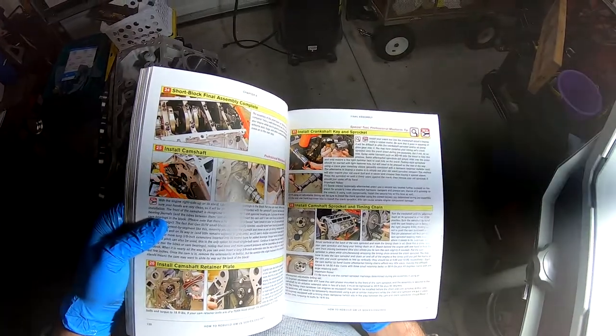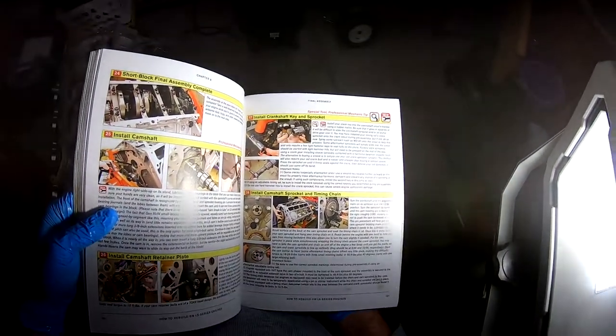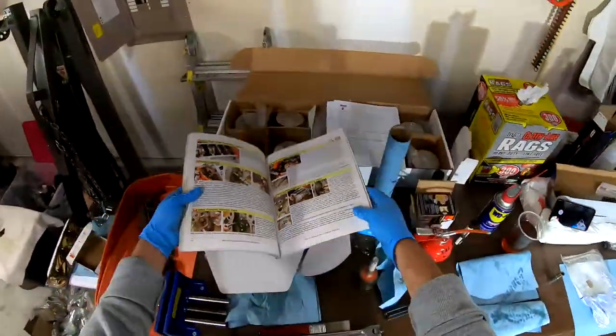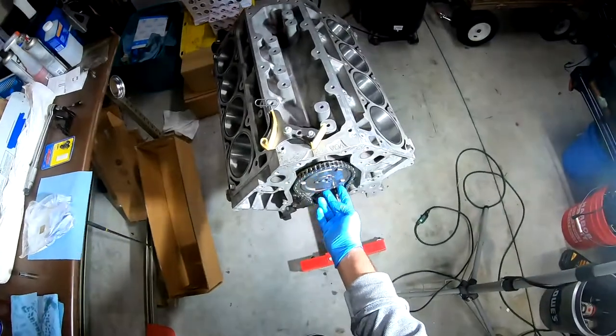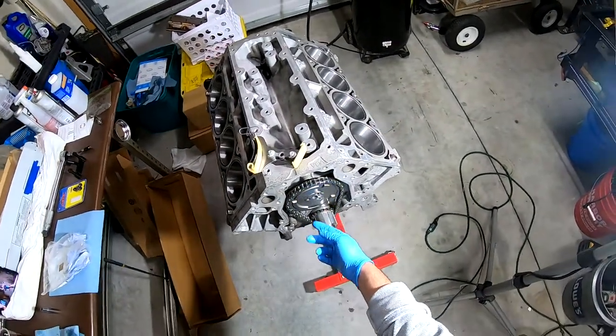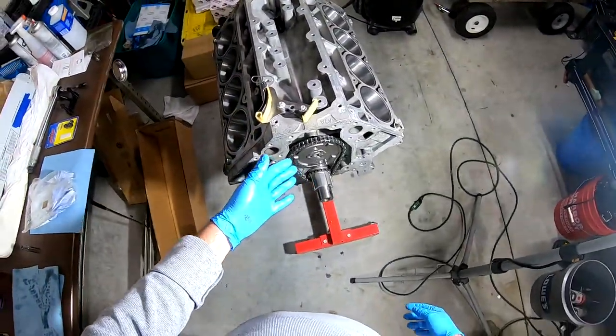Engines equipped with a timing chain dampener, which sits in between, should install it at this time. All right, so we're not using a dampener, because that looks like a bow tie, or a bat wing, as it's called, going in between. We're using the tensioner, which I should have put on before I put the...